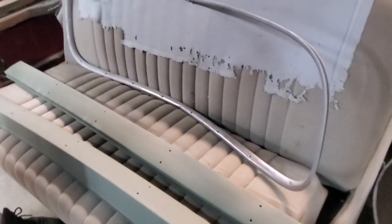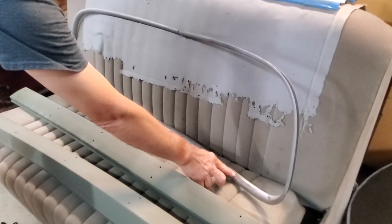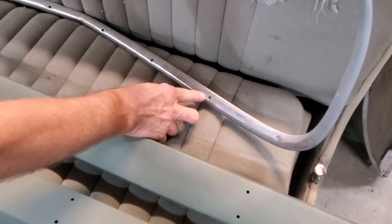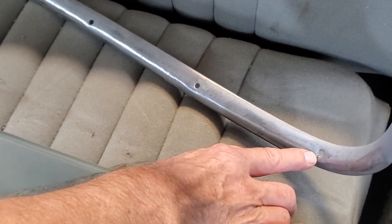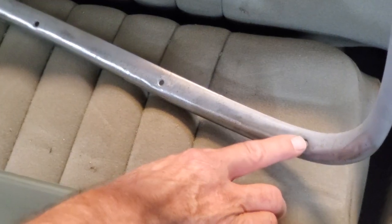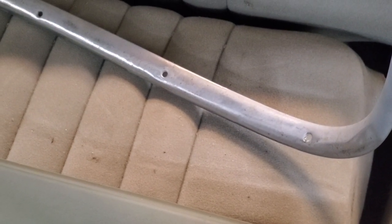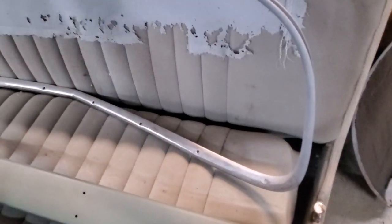Here we have the front window screen, which turns out to have two problems being worked on. One, it was crushed right on this spot that's been brought up to an extent so we can redo it, probably put a little filler in here when we're done. The other thing is it's been sort of cut in this area — I'm going to have to spot weld that and dress it up so it'll be good. Otherwise this would have gone into prime, but those two particular spots need special work.